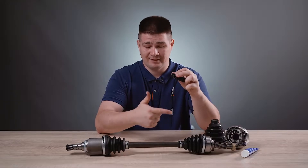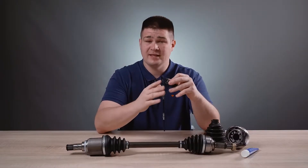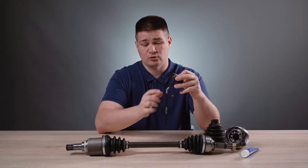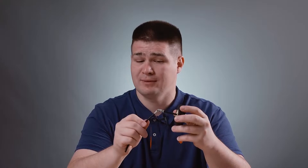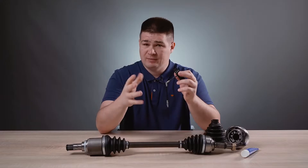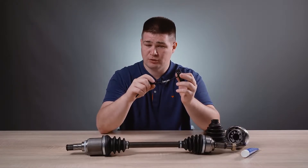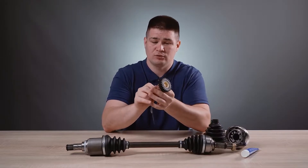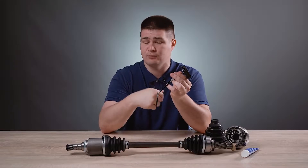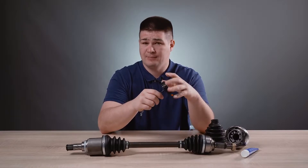On this model I showed you drive shafts. These drive shafts can be seen from underneath on some trucks. Drive shafts have two significant drawbacks. The first disadvantage is that they can't be bent at large angles — when bent at a large angle, it becomes problematic to transfer rotation to the wheel. The second disadvantage is that the drive shaft transmits rotation unevenly. If I evenly rotate the primary shaft, the wheel will rotate with some accelerations. It's hard to see with the naked eye, but on a scale it looks like it twitches, even though I rotate the input shaft evenly.